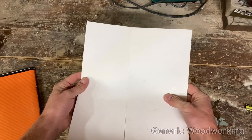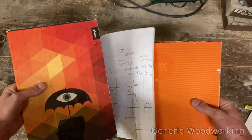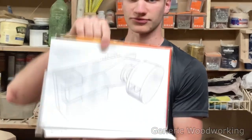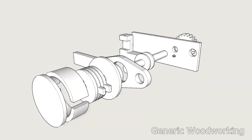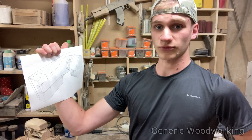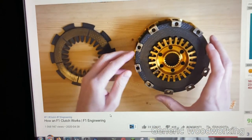To fix this on the new design, instead of using two plates to generate friction, I'm going to use a bunch of them, which should make it nearly impossible. This design uses multiple friction plates to make the clutch work better. I thought pretty good about coming up with this design until I learned that Formula One has been doing it for multiple decades now.